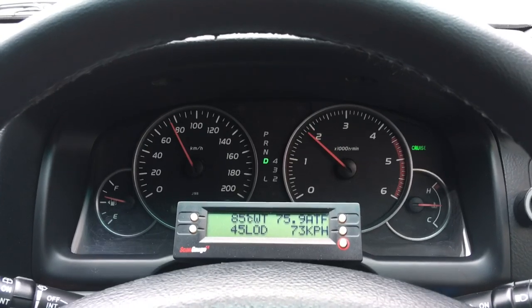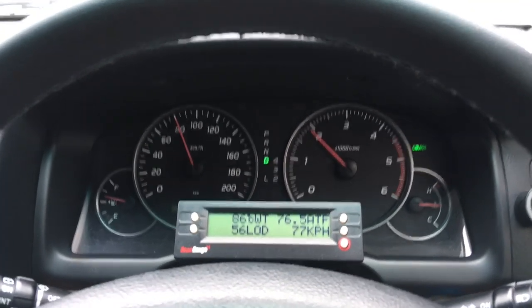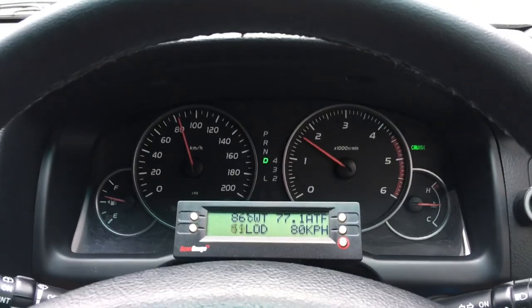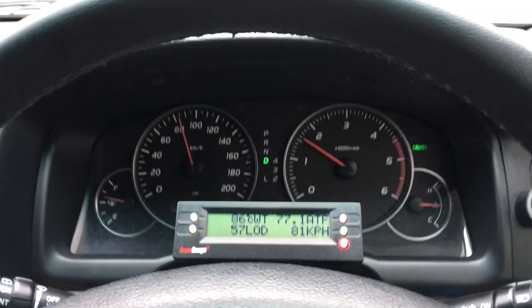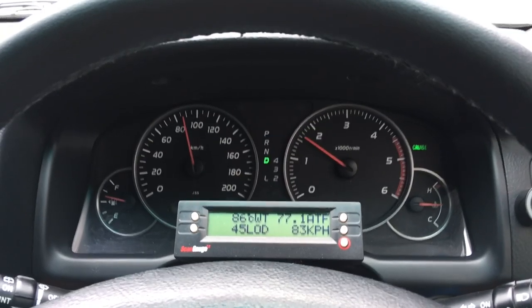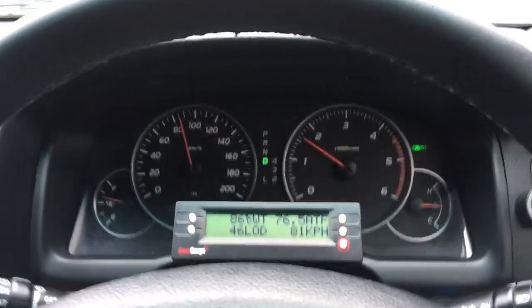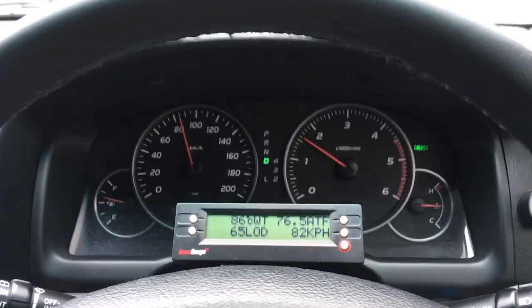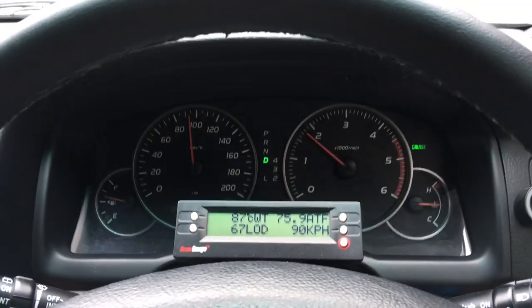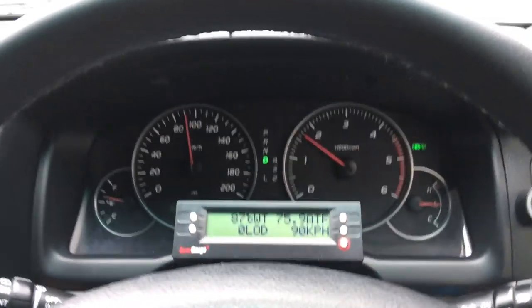If you stop for a few minutes it's going to cool down. If you're on windy roads where you have to keep slowing for bends, I suggest using less fuel to get going to the next bend — you'll use less brakes and save fuel, save transmission temperature and load. In fifth gear, see how low the revs are. Because this vehicle has good solid torque from its three-litre engine, I'm lightly accelerating — the load is going up — and the speed is increasing with no torque converter unlock. You can't do that in a 1GD.